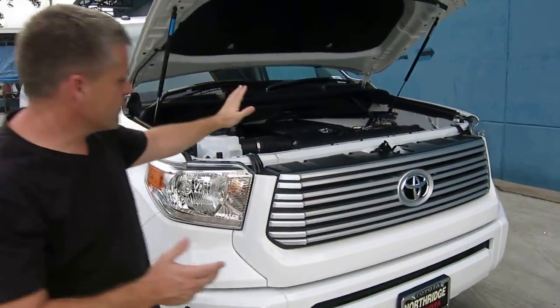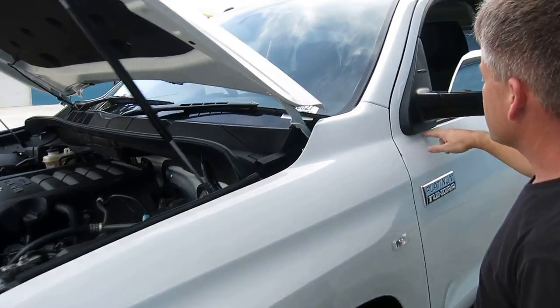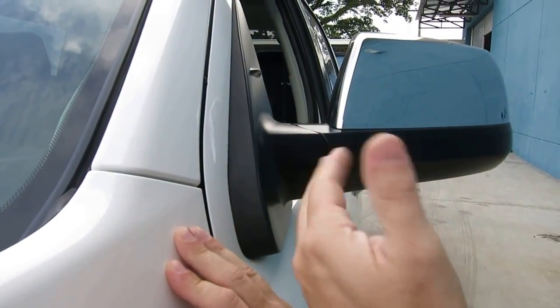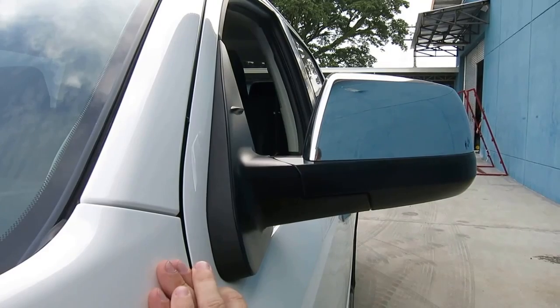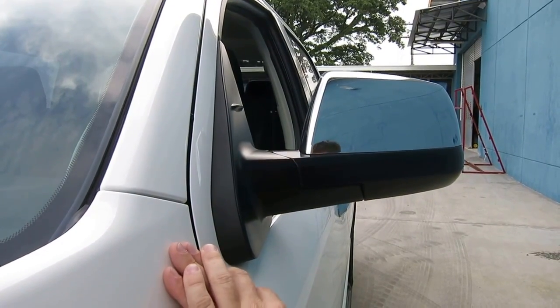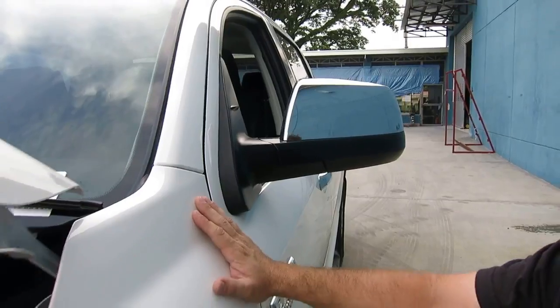Just a quick thing on this side over here - we've fitted the mirror wedge to the vehicle. That mirror wedge has been fitted to allow for additional driver's view out of the passenger side mirror. Like all American cars, the offset of the mirror is handed to the driver's side, which is the left-hand side. So all the vehicles need to be fitted with that wedge, which makes it easy to see for the driver.